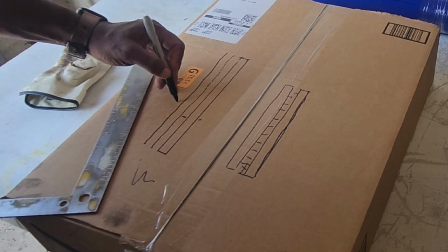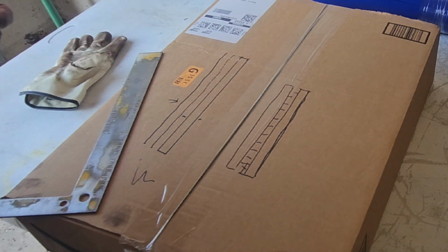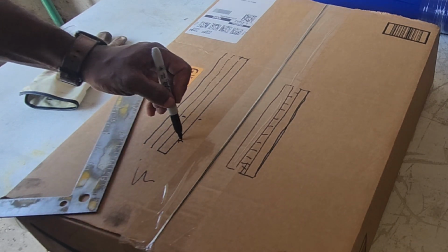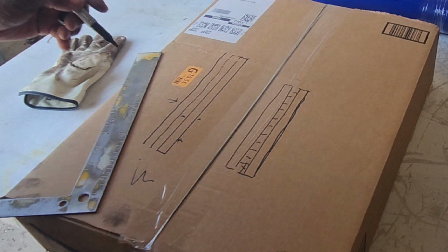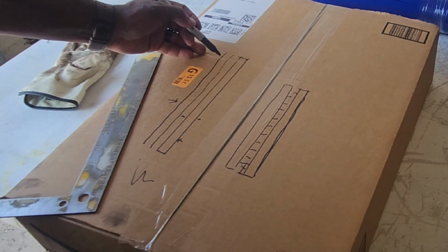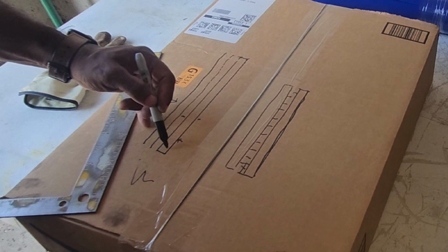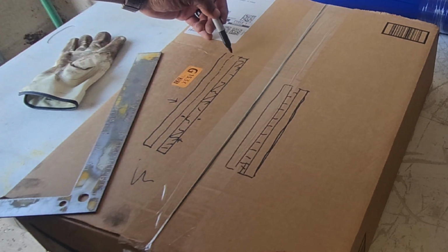Well, if this is the outside and you're turning the rotor, because it's a vented rotor, there's no way to cut the inside of it. You can cut the outside of one disc and the outside of the other disc, but you can't cut the insides of the disc, which would be even worse. But anyway, now that it's wavy, when you get your rotors turned, what they do is they pick the lowest spot and they cut out all the high spots so that the low spot is all that remains. So that we don't lose track of what's going on here.